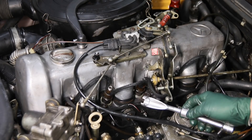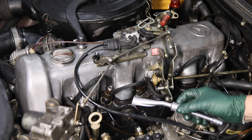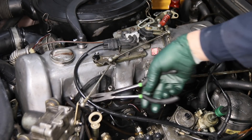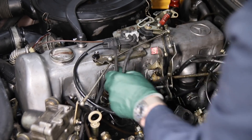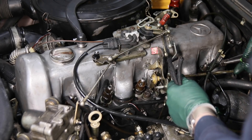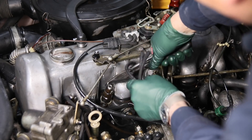I believe every diesel owner should have one of these wrenches — it really makes life a lot easier. I'm going to try to get the price low enough and I think I'll include these silicone caps with the wrench. There's also another wrench that can be purchased separately, which is the special wrench I have engineered here in the shop to get these hoses on and off easily. If I'm going to remove my fuel injectors, I've got to remove these injector hoses. If the hoses are fairly new, this wrench will actually prevent damaging them so you can reuse the hoses, but most of the time if these have been on for any length of time, you need to replace these rubber fuel injector hoses or you're going to have leaks.